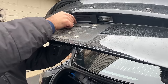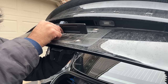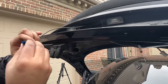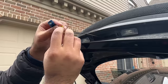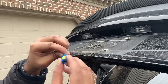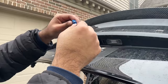I found it easier to remove the license plate for this step. You can remove the entire camera assembly but you can also leave those plugs intact. Pass the wire we routed from the bottom through this opening and we need to reinstall the blue plug we disassembled earlier. Simply slide the metal piece into the blue housing and insert the yellow piece — this yellow piece has a little notch, and if you face that towards the tip of the clip, it goes in easily. Next, go ahead and make the camera connection — push on the clip and you will hear a click when they secure.